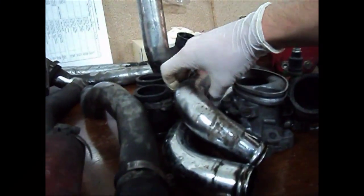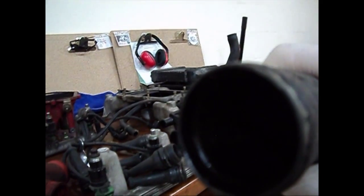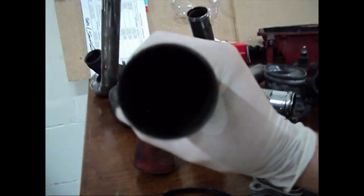These are the boost pipes — this one goes directly out of the turbos, the lower part. These are the upper parts, going to the intercoolers — it has two of them. Looking inside with some light, it's pretty much covered in oil, as you'll see. In direct sunlight it was clear as day that it's all filled with oil. The car was also overheating constantly, and this is a main reason why.